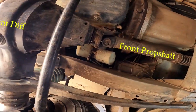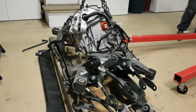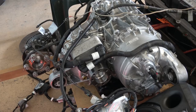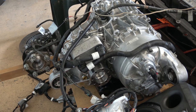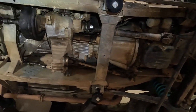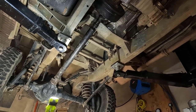This all sounds fairly straightforward — I just need to weld up a frame to support it between the chassis rails and graft the Land Rover prop shafts to the Tesla outputs. It will even rotate in the same direction to provide forward motion. There are some issues I'll have to address though. First, there's the gear ratio. The reduction gear in the Tesla is just over 9 to 1, which gives the Tesla a top speed of around 260 kilometers an hour. This reduction ratio won't work in the Land Rover because the way I'm mounting it, the outputs will go to the Land Rover's front and rear differentials, which changes the ratio by about 3.5 to 1 — resulting in a top speed of only about 80 kilometers an hour.